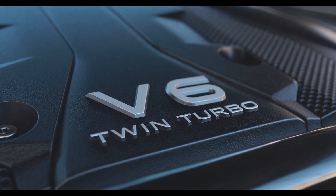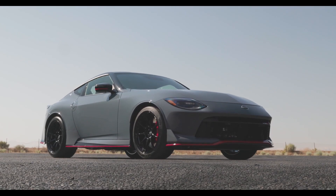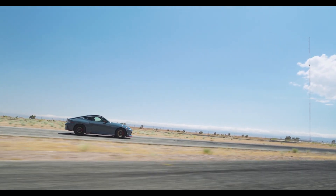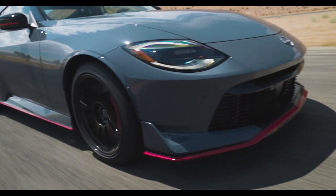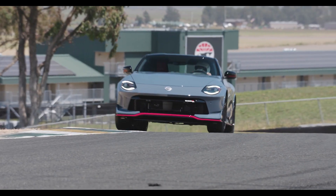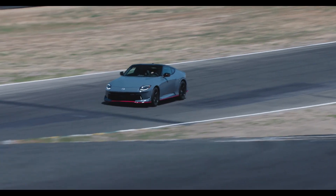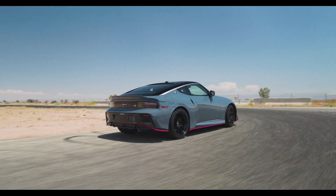Take them to the track and the Z NISMO will eat the Z for breakfast. The Z NISMO has a few aerodynamic improvements that will help it enter corners much faster. The mesh on the front grille is thinner, which allows more air for cooling, and helps alongside the canards on the corners and side sills to reduce drag and lift. In corners, the car needs more traction — that's where the new taller and wider rear spoiler comes in. It's split in three pieces that extend to the rear fenders.